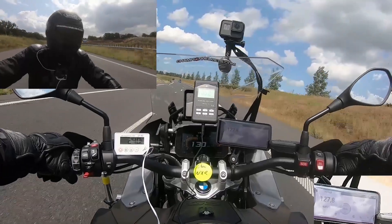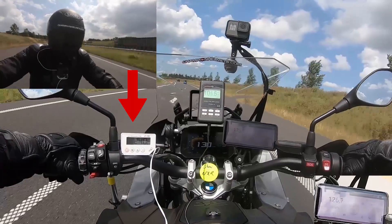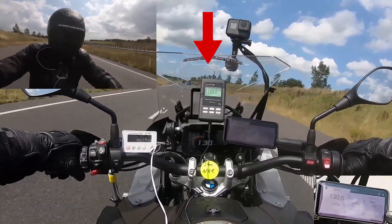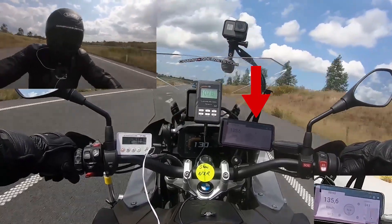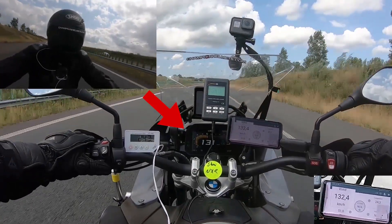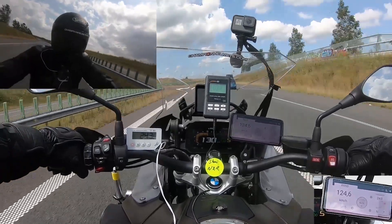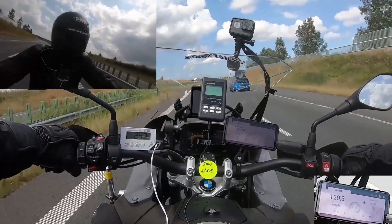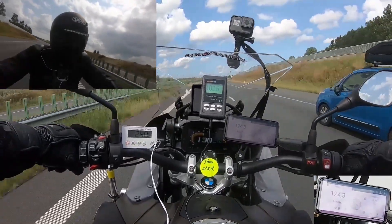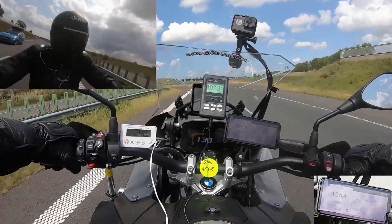Let's see how this helmet does on the road. A quick reminder on how we set up our road tests: on the left is a white monitor showing the helmet's temperature from a thermometer placed on top; in the middle is a decibel meter giving values from a microphone near the rider's ear; on the right is a phone measuring wind speed; and on the dash we have rider speed and exterior temperature. We took the NXR out on a nice sunny day. The external temperature was about 24 degrees Celsius while the helmet's temperature was about 23 — so about 1 degree less. The wind speed was 120 to 130 km/h. We recorded a noise level of about 103 decibels, which is pretty loud.